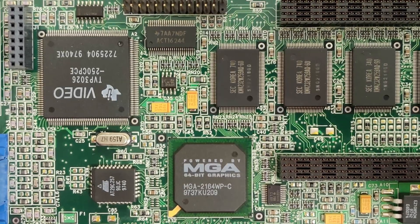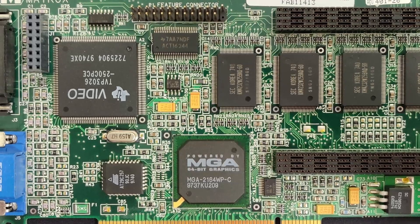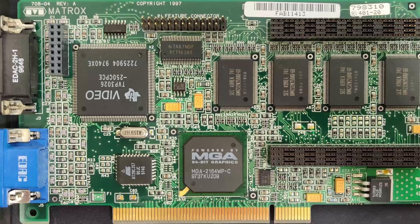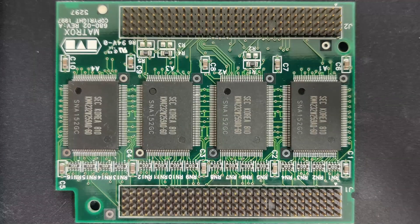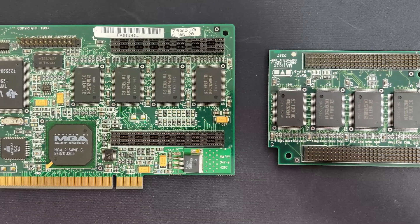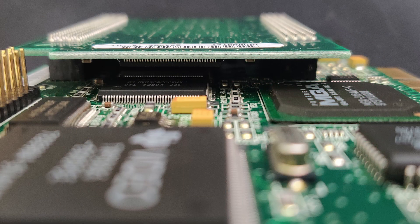This graphics adapter is also a new addition — the Matrox Millennium 2. It is not a good 3D accelerator but it is DirectX 5 compatible. The model you see here is equipped with 4 megabytes of onboard video memory. I also have a memory expansion board which will double the total video memory to 8 megabytes. Matrox cards were known for their outstanding image quality, and they pioneered the multi-display GPU which paved the way for multi-monitor desktop setups.